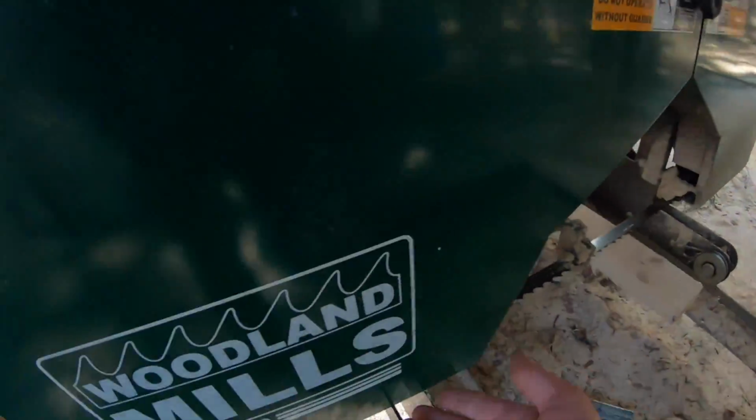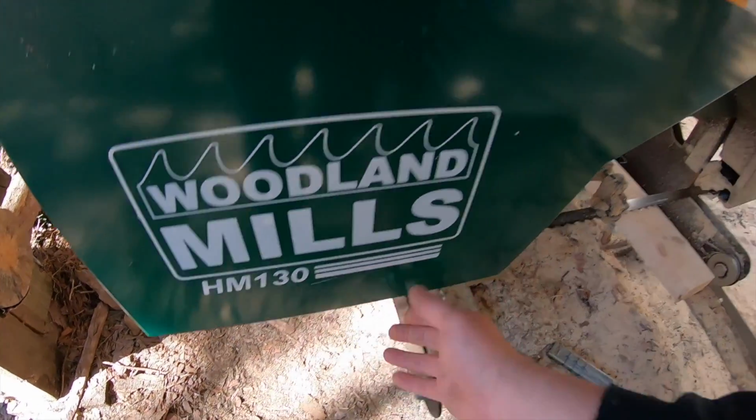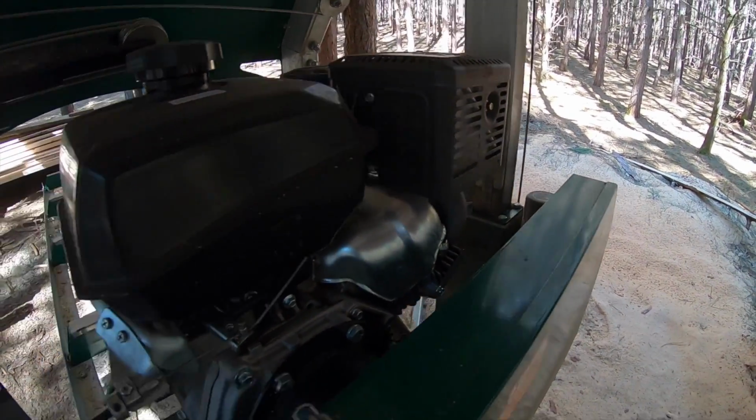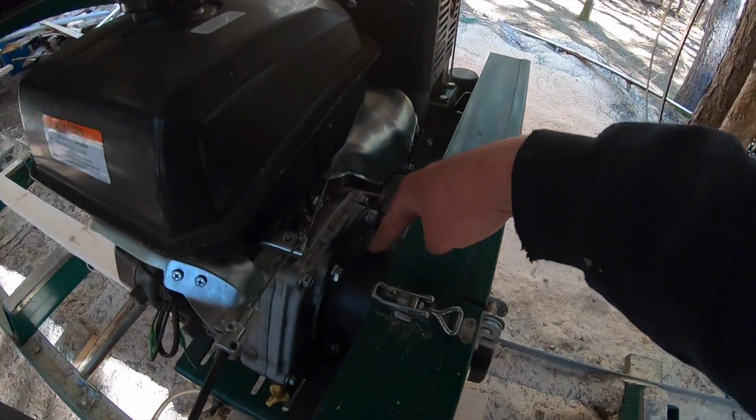There is no ping sounds. The only thing you might hear is the odd little bit of rattling. Hear that? Little bit of rattling, and all it is, it's just the door vibrating slightly. There's no other ping sounds. There's nothing else. If you hear a ping sound, especially coming from here, that is your clutch engaging prematurely. Having that engage prematurely might sound like this.